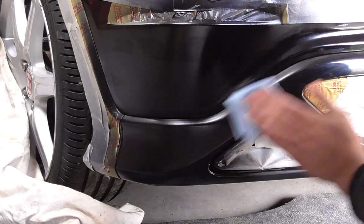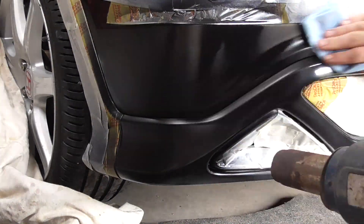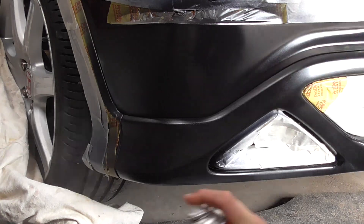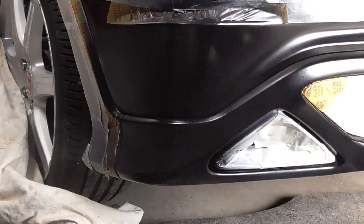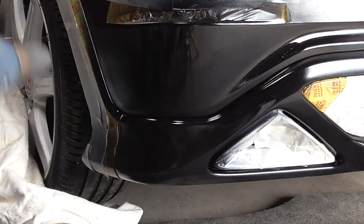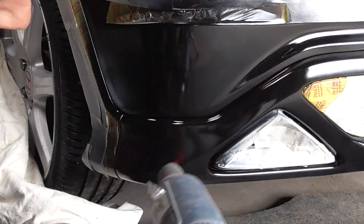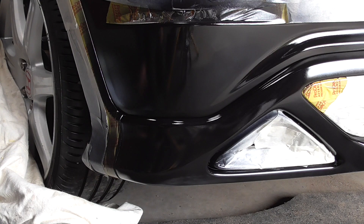When the new paint is fully dry, it's time to apply the new clear coat. In this example I'm using a standard store-bought aerosol clear coat, a 1K automotive lacquer. The first job is to make sure the panel is properly clean and free from any contaminants by giving it a wipe down with panel wipe degreaser. The application of the clear coat isn't too dissimilar to that of the paint — I start by laying down several light, dusty coats across the whole area while simultaneously warming the area with a heat gun, before moving on to a few heavier, wet coats towards the end, being sure to keep the panel gently warm throughout the process.